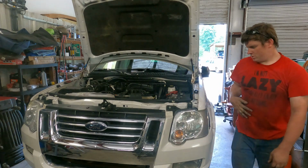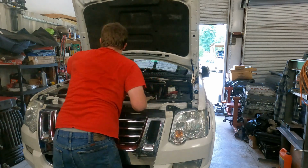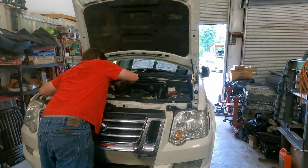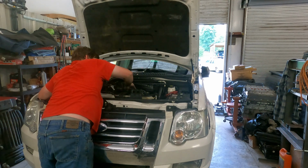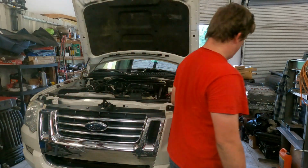All right, check the fuel and check around. Don't smell nothing. And the fuel line's dry. You can't really reach the injectors too well on this thing. I'll touch what I can of them though, make sure they're not leaking. I don't see nothing. Well, feel nothing. Let's fire it up.